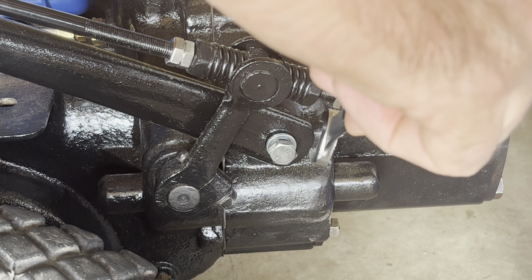One word of caution: if you set your clutches and you find that they keep going out, they keep slipping around and the adjustments won't stay put, check this bolt right here. If this bolt isn't nice and tight, this lever here will slip around on your shaft. So always double check these just to make sure they're snug, otherwise you could end up chasing your tail on this whole process. So that's all there is to it — that is how you adjust the clutches on a Gravely Model L garden tractor. Thank you for watching, please like and subscribe and I will see you on another episode.